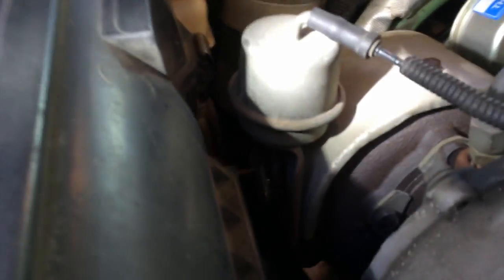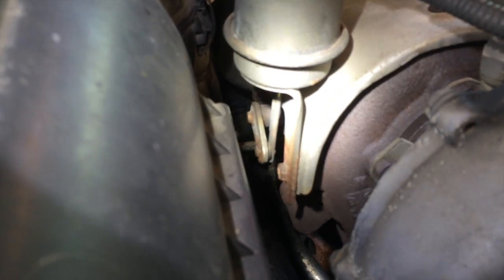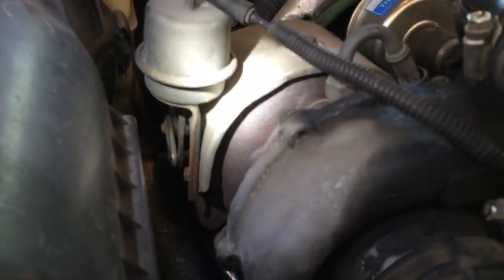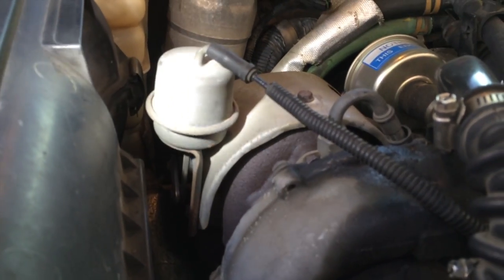The way this works: there's a lever underneath the actuator — you can see it on your own vehicle. When the vacuum goes up, this lever pulls up on that actuator arm, and that's what operates the flapper valve called a wastegate. The wastegate determines how much exhaust gas from the engine is routed into the turbine of the turbocharger versus exited out the vehicle as waste gas — hence the name wastegate.